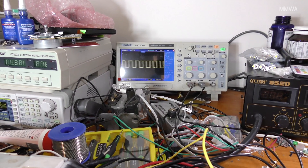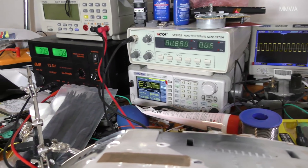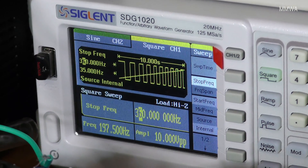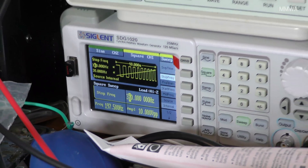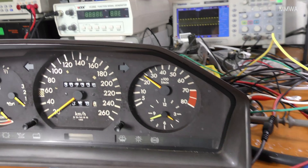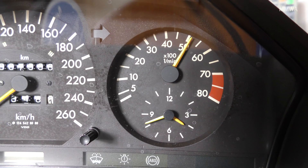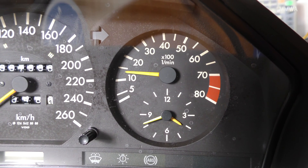This is just my setup with an instrument cluster from the red car. You may have noticed that it's quite sun-baked — I'm still undecided if I'm going to use that. This is the signal generator that I've set up using a sweep starting from approximately 500 RPMs to slightly over 7000, so as to activate the fuel pump cutoff in the mass relay.